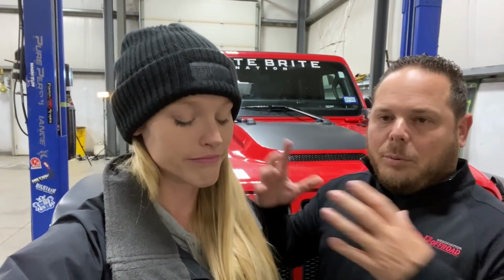We wanted to make sure that we've had enough road time and enough off-road time to really feel what the factory pickup points can do. And of course, we've been running Metal Cloak forever. We love it. That's been great. But long arm is just the next evolution of the build. Yep. And that's where we're at. So we're going long arm. And we are changing the rear to a 3-link.